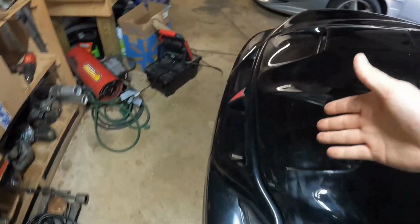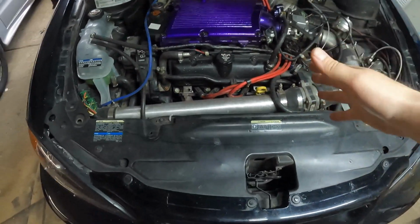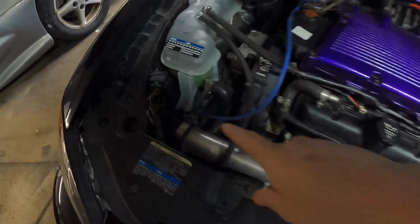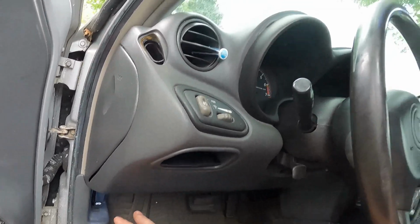And what the Casper wiring does is it plugs everything in. It's basically all plug and play. So it still retains all the factory workings of it. Here's all the relays for it, and it just basically activates the high setting on the fly. And then I can open up a book and I will show you guys at the PCM what leads to tie into to do pretty much the same thing. Brad's car, we did that. I put 2 switches down below right about here, and one kicks on the low setting, one kicks on the high setting, but it doesn't really interrupt the factory wiring. So yeah, let's go take a look at that.